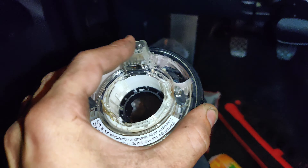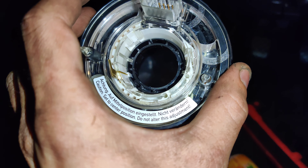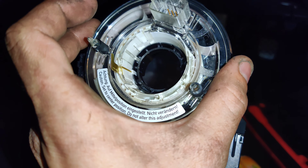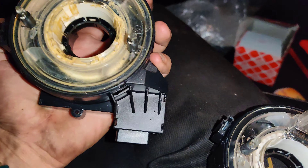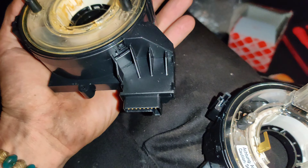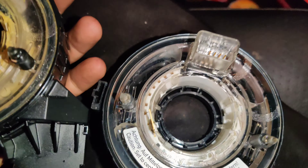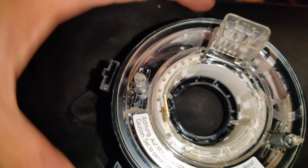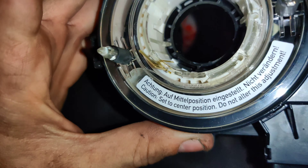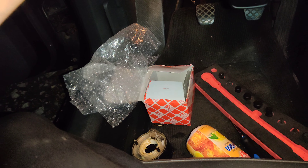So guys, we're back with the Jetta. I just pulled it all back apart again and got a new clock spring. Here's the old one. I want to show you guys something that's pretty neat. This one has a locking tab right there - it doesn't allow you to turn it more than that. See that copper pin? It's like a detent. So when you try to turn it, it stops. When you go the other way, it stops. This one doesn't have that - see, there's no pin.